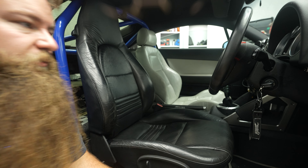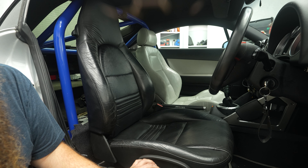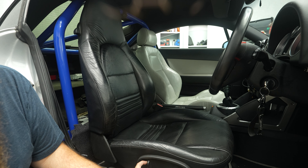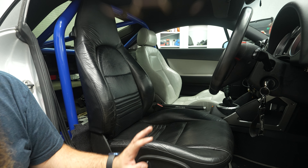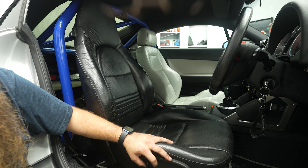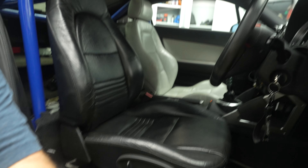A little bit more involved than I thought — it has electric power folding rears when the ignition's on, so I put it on an ignition switch fuse supply. Now it has that part electric. I didn't realize — I thought they were both manual. So it's got manual height adjustment when you pull the ejector seat lever upward, then the rear fold is electric, and then the front going backwards and forwards is from the normal lever. Let me show you on the other seat how the power works.